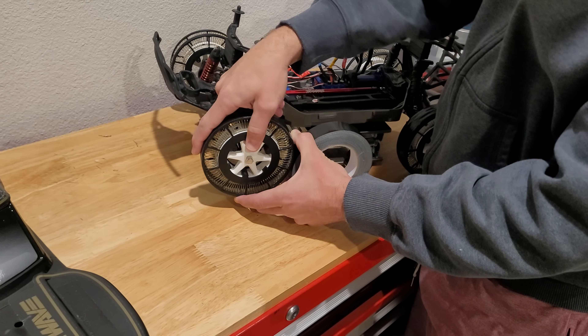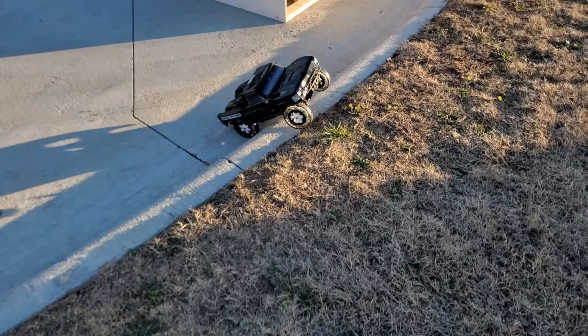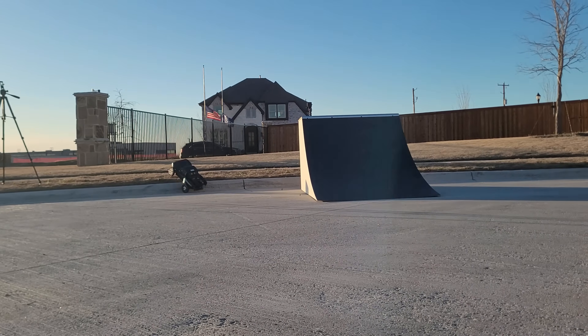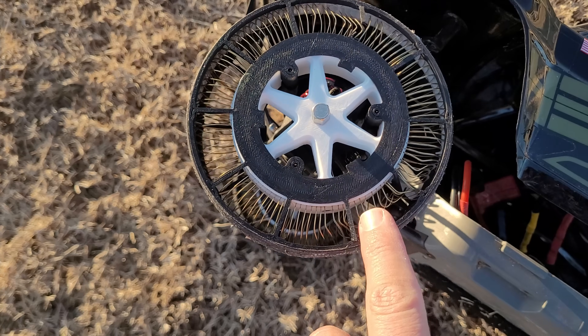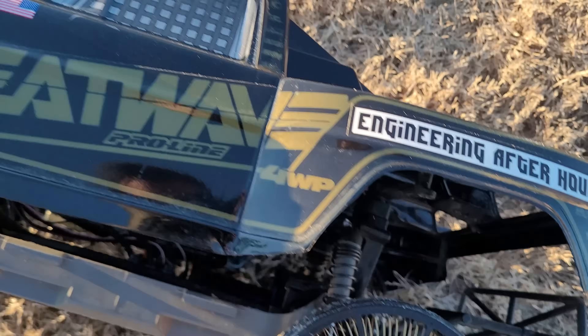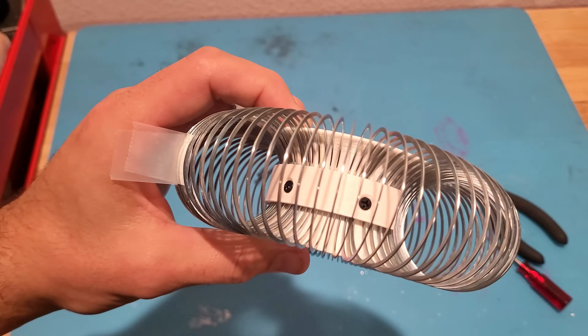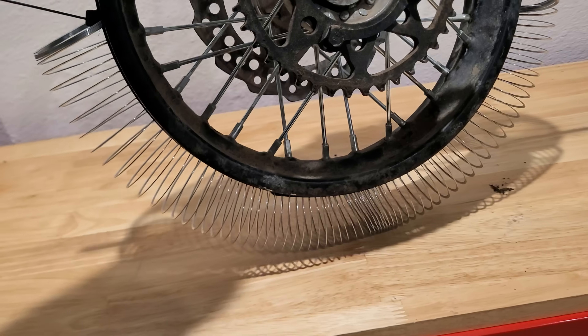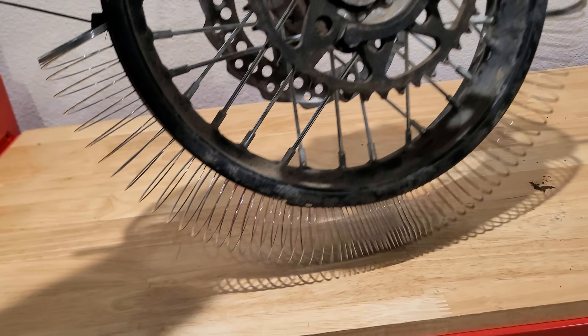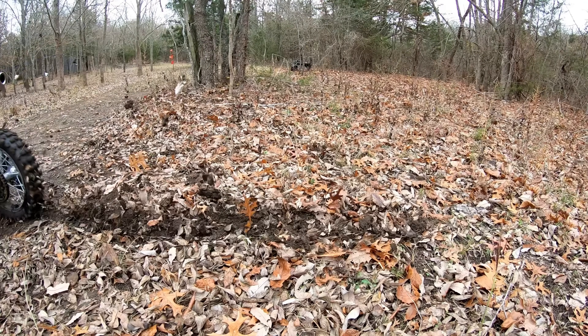The outer reinforcement around the slinky helps a lot with load sharing and the ability to continue operating when a portion of the wheel is damaged from a curb check. We also know that the slinky needs to be clamped and bonded very well to the rim, or it'll immediately fold over under almost no load. I feel like that's enough to step up to the big leagues with the pit bike — so let's go.